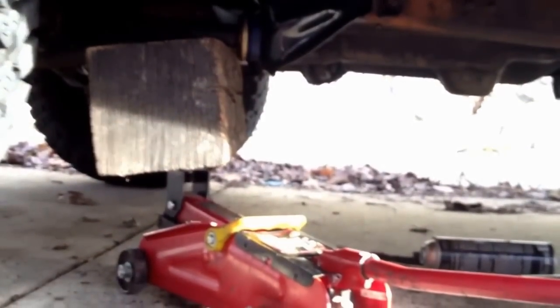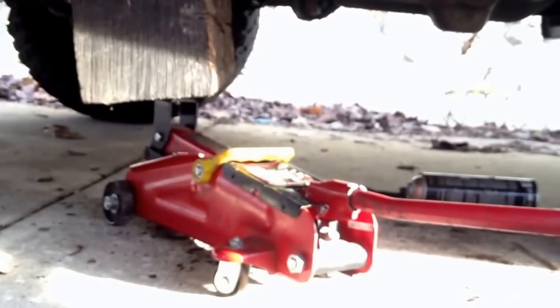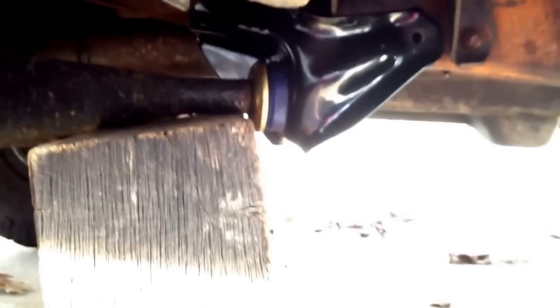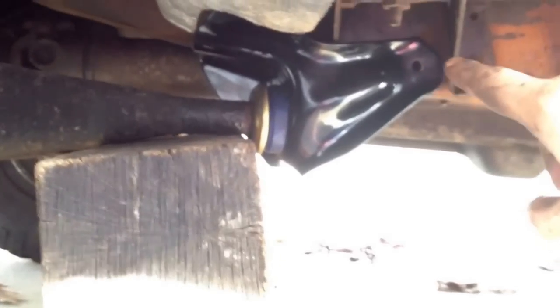I had to get a little creative to jack up the radius arm. I've got a small jack with a block of wood between it and the radius arm. The reason is that it's very difficult to push the radius arm back into place and line up the bolt holes by yourself — you'd need a friend. But this jack holds it in place while you line up the bolt holes. It's pretty close as it is, so I'm just going to move the wheel forward slightly to line things up better.